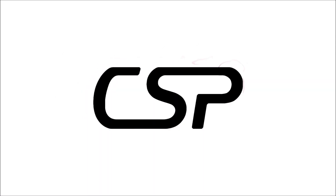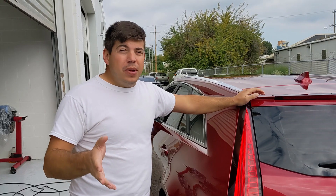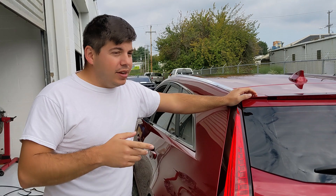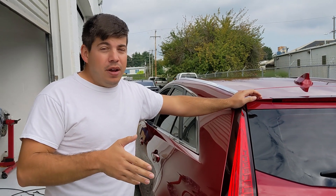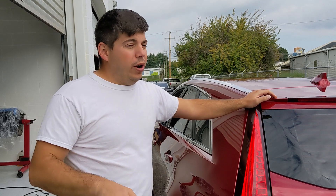Man, I hope I don't lose to a Tesla. So we know that the Plaid is fast and the wagon is fast. The wagon was a little bit slower down at Beach Bend Raceway. It's partly due to prep, but one thing I noticed is that in the top end, the Plaid just has more legs than the wagon, which is really weird. What I've determined is the factory torque converter is slipping a little bit when it shouldn't be.